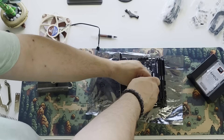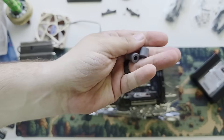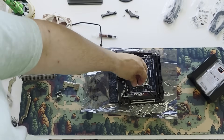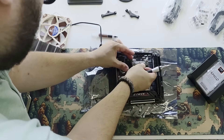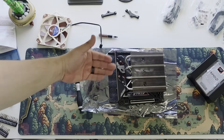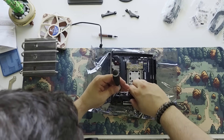After removing the pre-installed mounting brackets, I'll need to add the provided cooler spacers and brackets from the NH cooler. The cooler includes two sets of brackets of your choosing, and the brackets include a guide on how to install, with guides indicated on the brackets themselves. After the brackets are installed, I'll place the cooler temporarily to ensure fit, before installing the existing 1TB NVMe SSD from my current build.